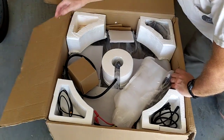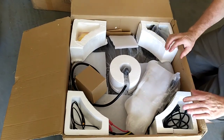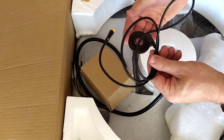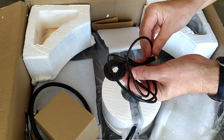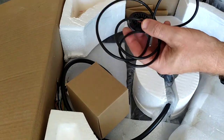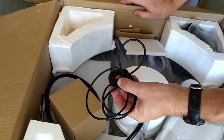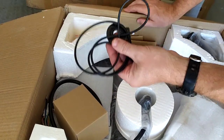Alright, you can see everything boxed up here. We have the controller. Here's the pedal assist sensor — optional if you want, you don't have to use this. This actually slows you down, not speeds you up, because if you put the pedal assist sensor on then you'll get full power only when you pedal. If you don't use the pedal assist sensor, then you always have full power.